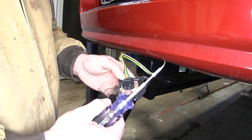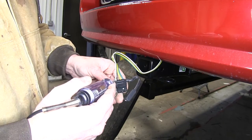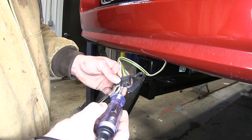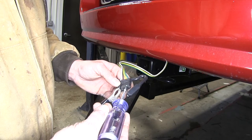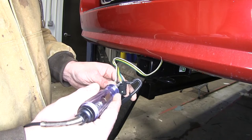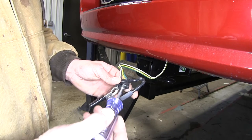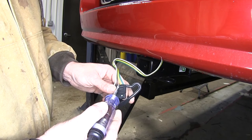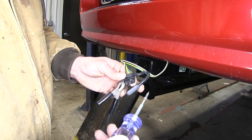You see we've got the bare tab that sticks out — we're going to use that as our ground so we'll connect our test light to that. The brown wire should get constant signal from our running lights when we make contact. Now we'll check our yellow wire for our left blinker — as you can see we're getting the intermittent signal that will flash with our light. Now we'll check the green wire for our right blinker. Now we'll have our buddy stand on the brakes and we should have constant signal on both the green and the yellow. Everything checks out — it's ready for use.